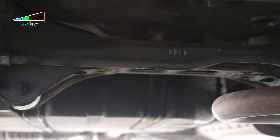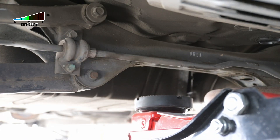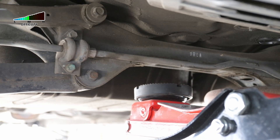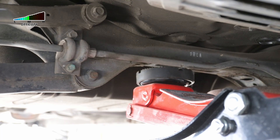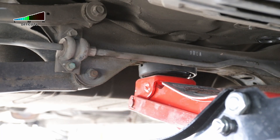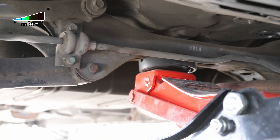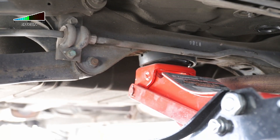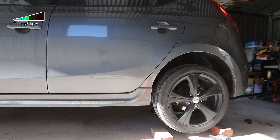Once the car is lifted in the front, I go to the rear and select the rear cross member — but stop right here, because there are some cars that cannot be lifted using the rear cross member. They usually have a warning sign and are typically small cars like the Suzuki Swift. If you use the rear cross member on these cars, it's going to bend and you will damage the car.